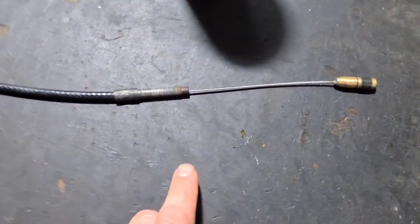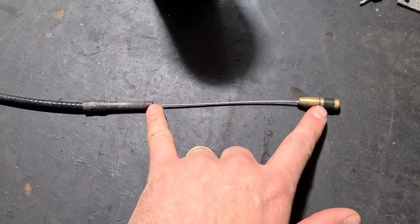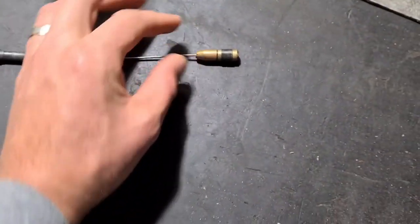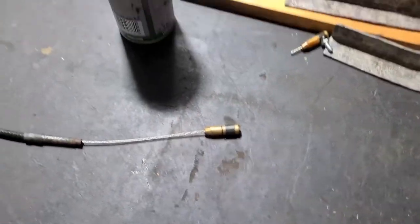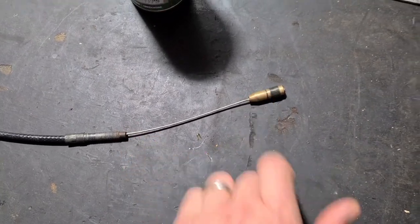You're safe either way, but I'll just use some battery crimpers. Keep in mind that your cable still needs to slide in and out of that sheath, so don't go too firm otherwise you've kind of buggered it. The other measurement — from the steel part to where the cable's going to be cut — is 135mm from there to there. Cable pull tight, 135mm, cut it. From there you are ready to solder on your coupling.